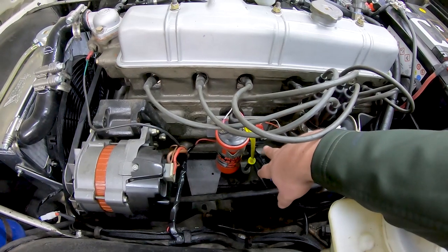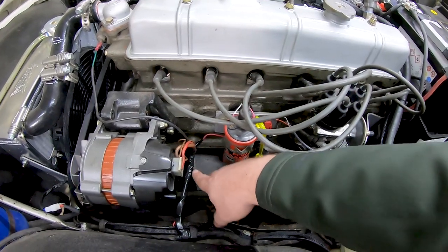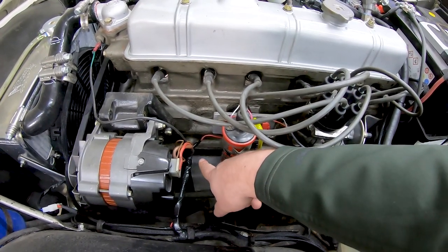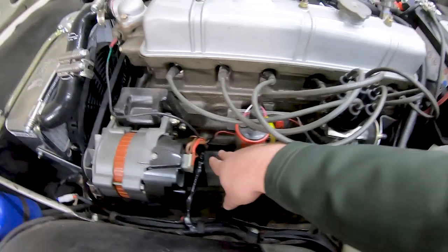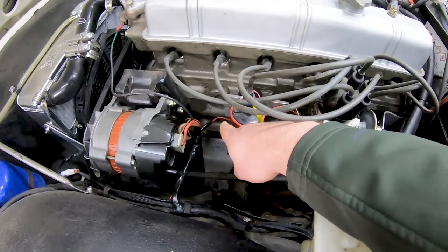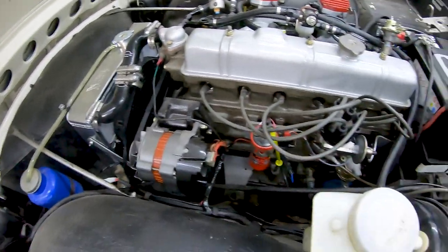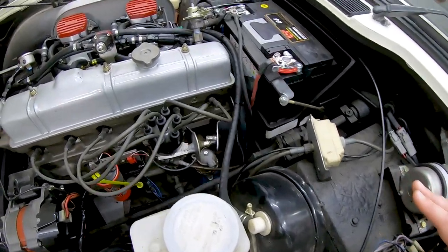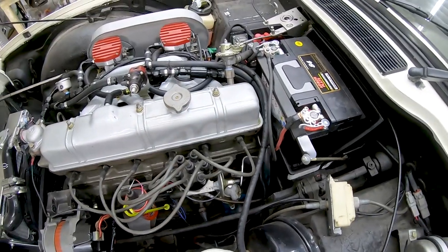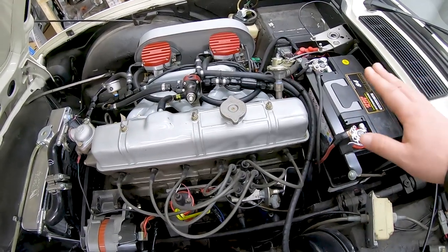That unit actually gets power just from the ECU, but that doesn't power everything — you still need to pull a positive feed from somewhere else that has a full 12 volts. I pulled it right off of the original wire that was feeding the distributor before, and I ended up cutting out a ton of wiring on this car because it was all terribly soldered and corroded. So I simplified it all down and rewrapped everything for the electric fans and all of that. I also deleted the fuse block and everything related to the old fuel system since they aren't needed, and the final installation involved a PMU-16 that got rid of all the other fuses and relays in the car. So electrical and fuel systems are basically completely different now.